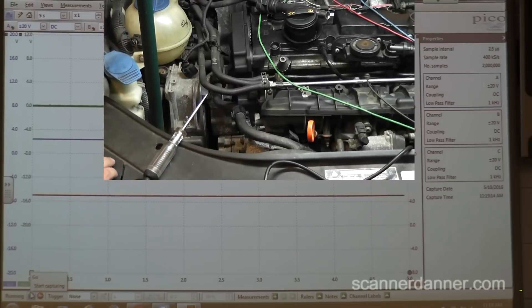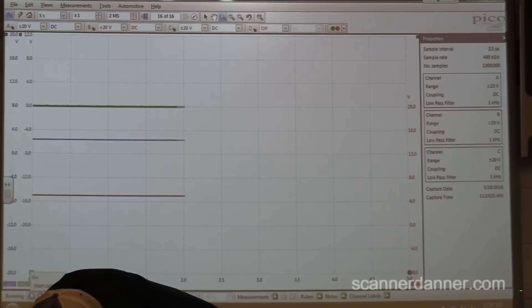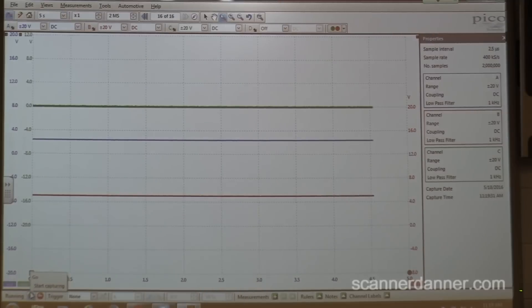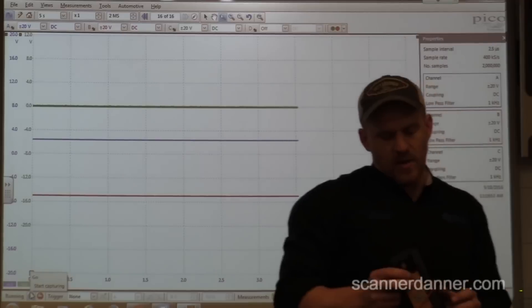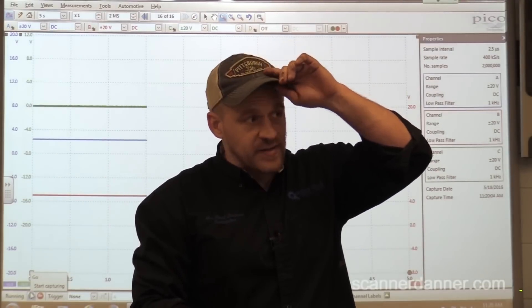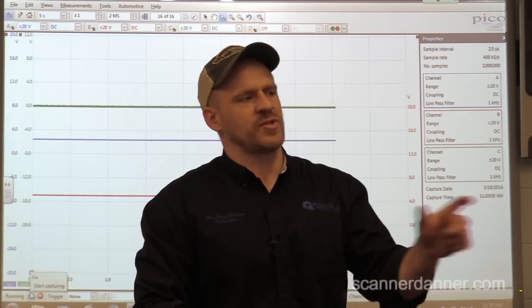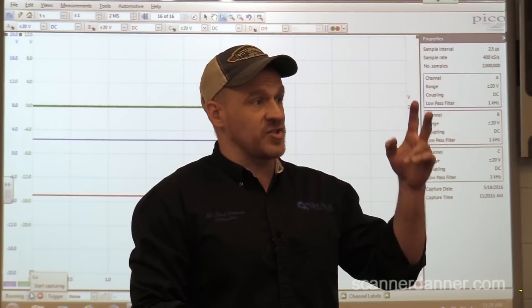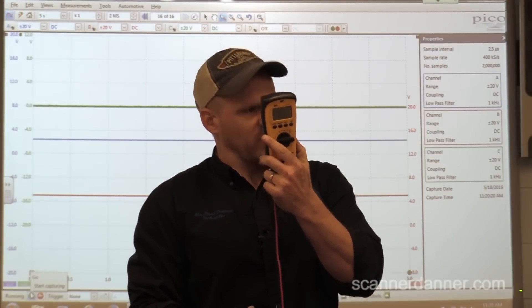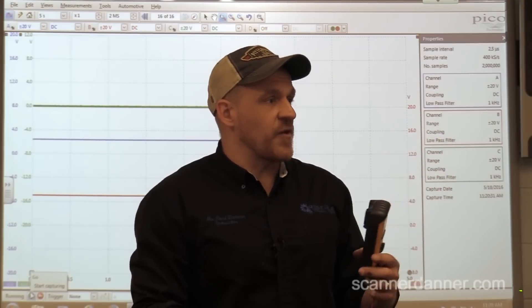Five-volt pull-down, just like Chrysler. All I know with that test light check is that we are on the signal wire for sure, and it is a 5-volt pull-down Hall effect design — the computer sends 5 volts to the cam sensor and the cam sensor pulls it to ground. All we know is our signal circuit is good. My next checks would be the 5-volt reference and the ground on that sensor to make sure they're good. And if they're good, we have a faulty cam sensor.